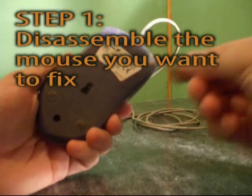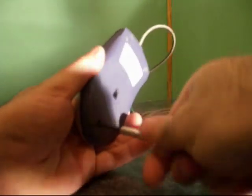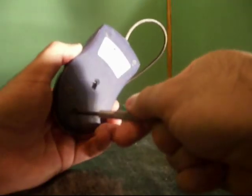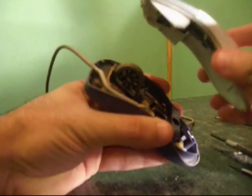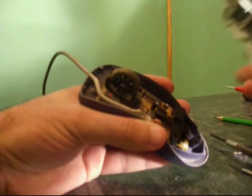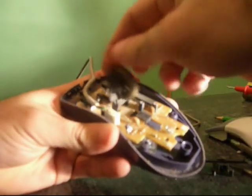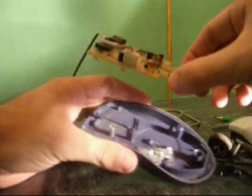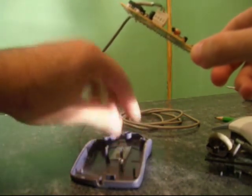I'll start by opening the mouse — this is a Genius regular optical mouse. I'll just remove the screw here. Different mice may have screws placed in different places. If you cannot find the screw, maybe it's under the label, so just search under the label. In most cases you will see there's a top piece of plastic and a bottom piece of plastic. The top piece is held by a screw on one side and some plastic clips on the other side. I'll take this removable piece off, then remove the scroll wheel so I can take the whole board out. Be careful with moving parts — there's a spring and a transparent piece of plastic. Try not to lose anything and remember where things were.